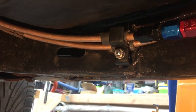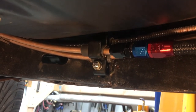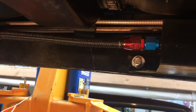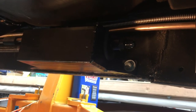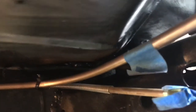Here is the tail section finished product. Bracket in place, holding the supply line which has the AN fittings on it. Behind it is the return line, and the very top wrapped in spring is the brake. All held nice and secure. The flex line allows some flex so that when that fuel filter behind the bracket comes out, it's easy enough to replace. Bracket is bolted on. There is an AN male fitting sitting out the front of the fuel filter that, once I have more of the firewall figured out, I will continue to run the supply line on top of those two and swing around and up the firewall, which is how I did the first car.